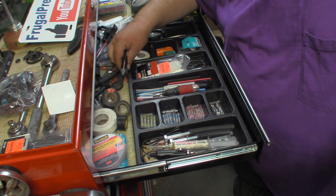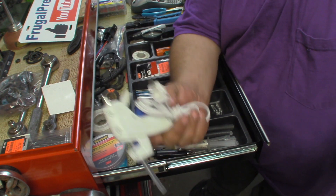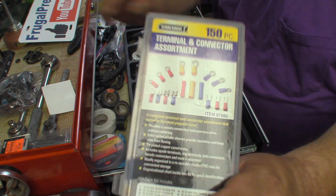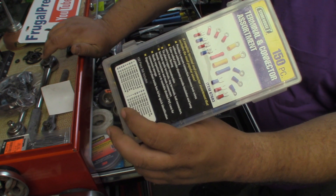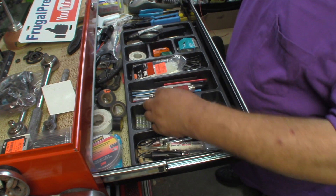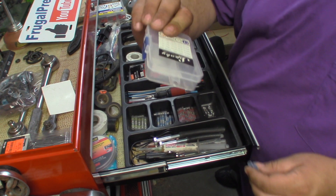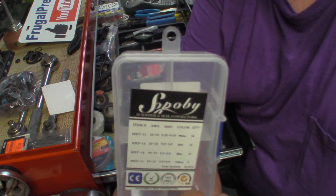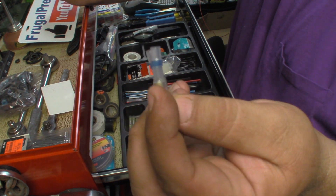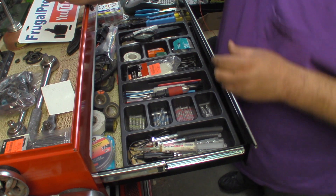My customers are usually very cost sensitive. I've got a hot glue gun — this comes in handy for a lot of stuff when doing electrical. I have these regular Harbor Freight butt connectors — if I use these I make sure I seal them up good with liquid electric tape. But I normally use these guys instead. These are — I got them on Amazon — they have low-temp solder in them and you just stick the wires in, hit it with a heat gun or torch, it melts the solder and heat-shrinks at the same time. They work really well, but they're kind of expensive.